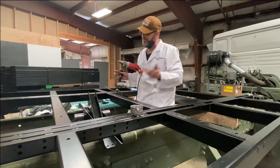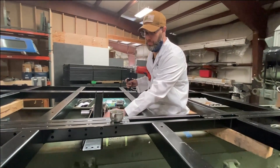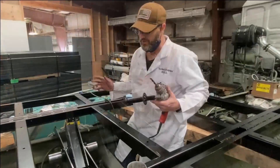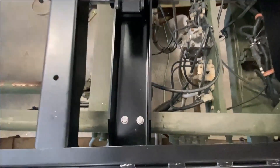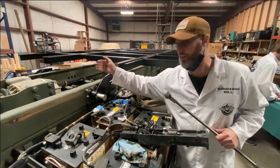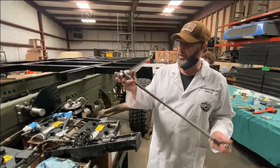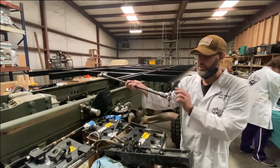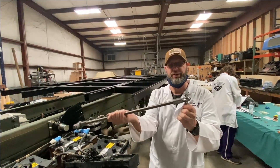Utilizing the whole piece gives more strength and rigidity, and it remains independent of the frame so the frame will still twist — no concerns in the field. You've got the option of doing what you want: you can even cut it flush and weld or bolt it on. Everything I like to do has a second option and a secondary backup fail-safe. Once the crossmember and truck frame have been drilled, insert and tighten the hardware to 40 foot-pounds of torque. There's a shaft collar that locks the frame in position so it will not shift side to side. In addition, on the three-point system only, a secondary pivot containment goes inside the frame to provide full rotational position of up to 12 degrees while preventing side-to-side movement.